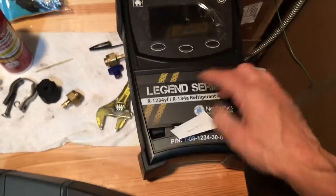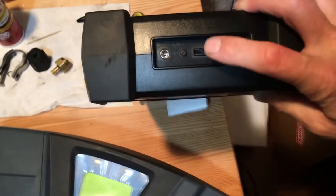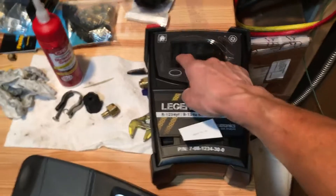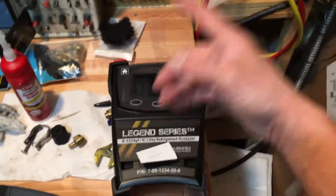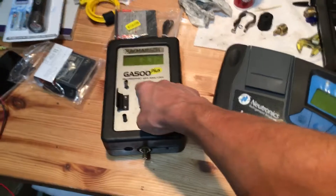This latest unit will be what you see in my upcoming videos. It can hook up to machines like the Robinair — it plugs right in through USB to the recovery/recycle/recharge machine. If it detects contaminated refrigerant, it will lock out and shut the machine down so it cannot recover the contaminated refrigerant and contaminate all your good refrigerant for recycling. This will be the new primary, the older one the backup, and the dying one will be retired to my recycle shop.